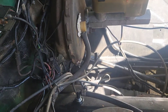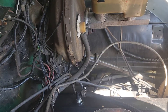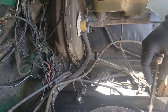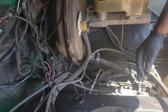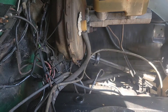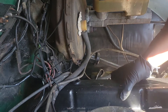The good thing about these old trucks is you can stand right inside and do everything you need to do, or just sit inside — however you want to do it. When removing components toward the back, be very careful — they're made of plastic. Pull it straight up; don't wiggle it. If it's not moving, rotate it to loosen it up, then pull straight up. Don't wiggle it from side to side or you'll have to go buy another one, and I'm all about saving money.